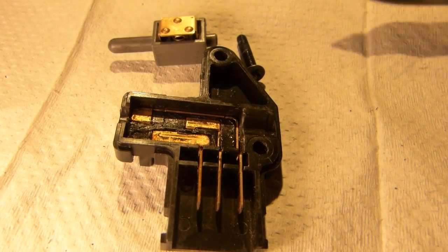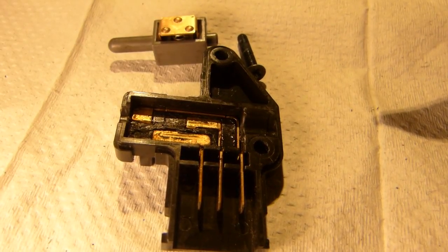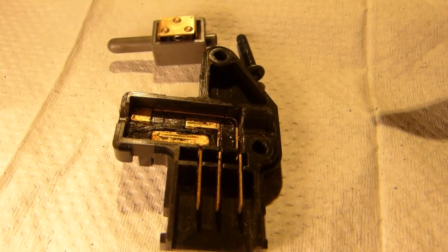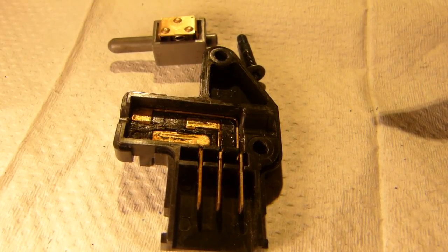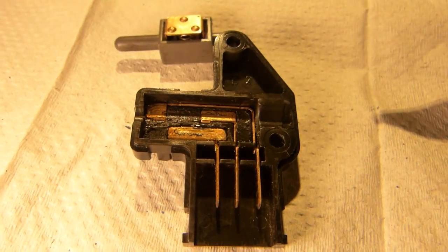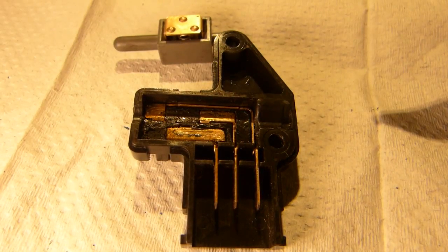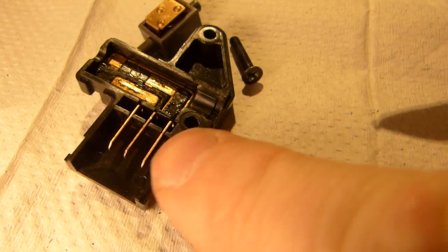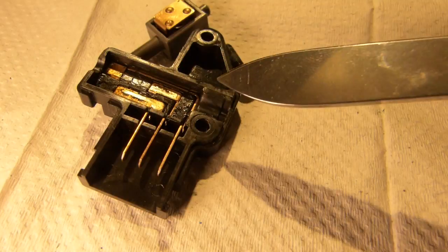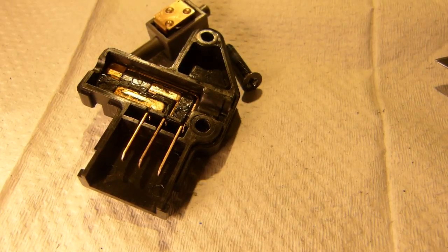This is why it's possible to jump the gap between the two places in the connector with a single wire, making the motorcycle fully functional but bypassing the plunger mechanism. This switch needs cleaning. It hasn't changed much since the 2003 ZZR 600 — possibly this switch and its plastic components come from the same injection mold. It was problematic on the ZZR 600 and here it is giving me grief again.